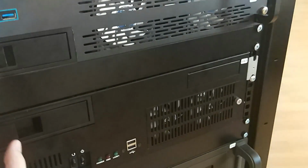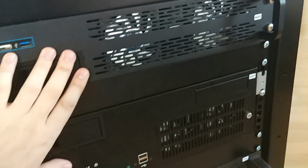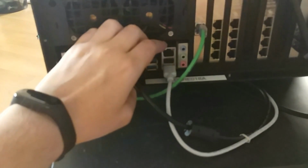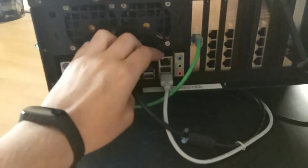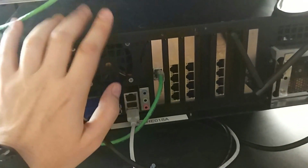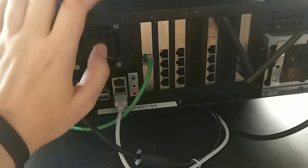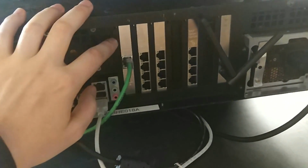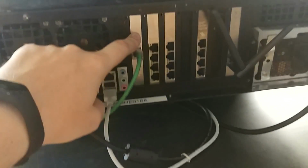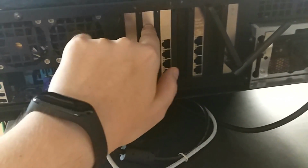With ESXi, basically you can cluster all of these, but this is the same CPU architecture, so there won't be any issues with that. So from the back, what do we have in these two servers? As you can see, in this server I actually didn't use the native gigabit port because there are some issues. It has a Realtek chip inside, and for ESXi it's best you stay with Intel or Broadcom or whatever has the best support, but I mainly use these HP cards because they all use Intel. So this is a single gigabit port Intel, and this is the NC364 like in the bottom server.